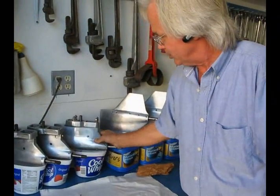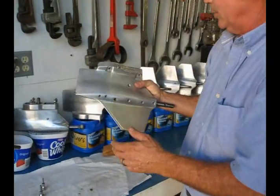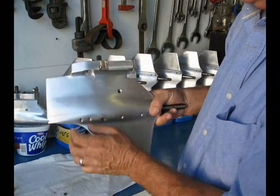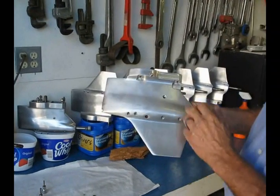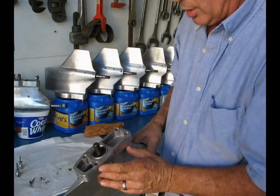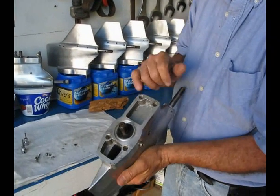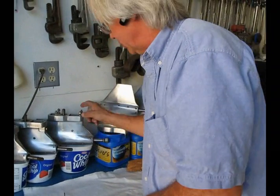This is what we call a super unit. You can tell a super unit by a couple of things: first, you're going to see this fitting in the back — that's actually for a remote oil reservoir. You're going to see a high oil fill right here and that's a dead giveaway. I don't give away what gear ratio I'm running so I have a code there. Also, we have to run them on a shouldered bolt so the unit stays perfectly aligned, so you'll see our lower units have 10mm holes through them.